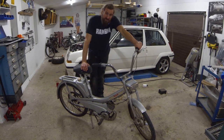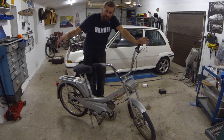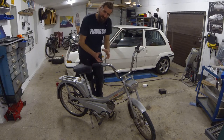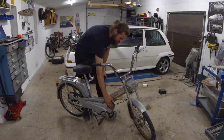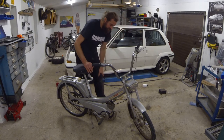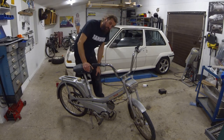I got it in pieces together with another moped. I ended up building the engine from the other moped, which was completely trashed, over onto this one because the engine on this one was also trashed. It's a Frankenstein engine — the head is from the old engine because it has mounts for the frame, and the other engine didn't. So I combined them and it works fine. I also changed the barrel to a new one, which makes the moped quite fast actually.